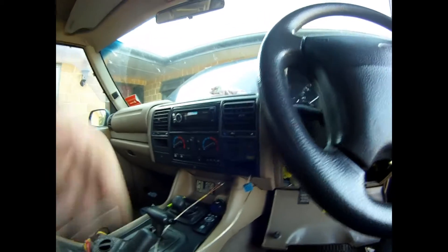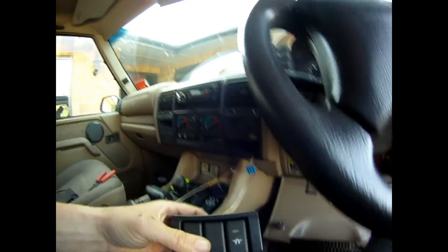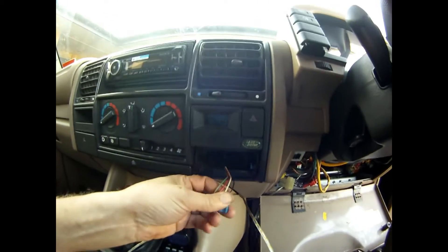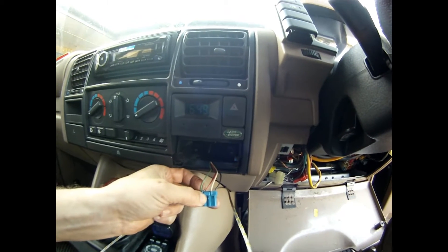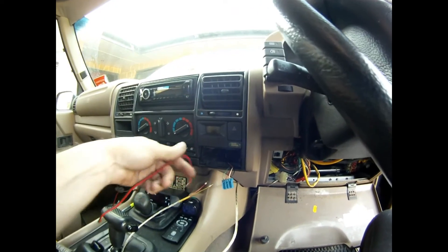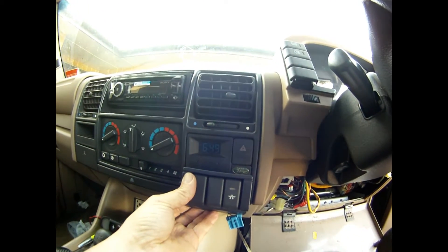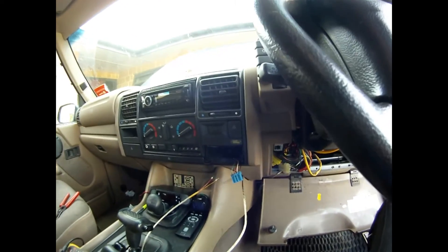Inside here my unit is fitted with the cruise control unit. I've taken it off and I'm going to piggyback off two of the wires to supply power to this unit, so that when I power it up it's all on the ignition switch. I've got an earth here, and this green and yellow wire that runs into the back of the cruise control unit is the 12-volt supply. So it's a really simple job — I'll piggyback the two wires onto the earth and the power, tuck all these wires up inside, plug it back in, and you wouldn't even know you'd tapped into it. If I sell the truck I can just remove this unit and take the wires out.